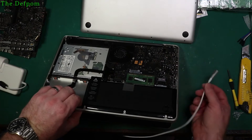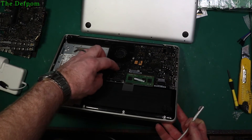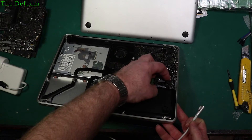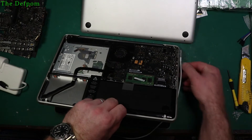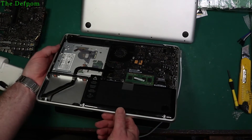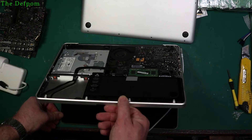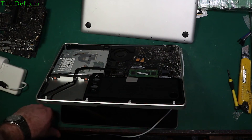It could be something dragging down the supply rail. I've disconnected most of the stuff — not everything — all these little clipping cables, the ones which just pop in, I've just popped all those out. Let's see what happens. I put the original RAM back in again. See if that changes anything. Sometimes it does. Something could be dragging down the supply rail.